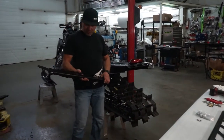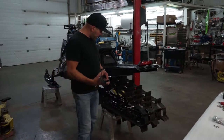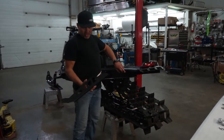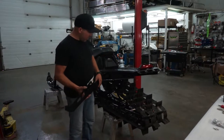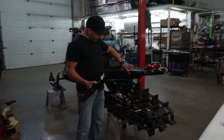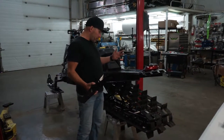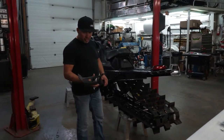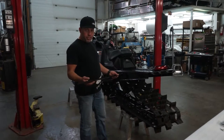So with these bumper kits, we've made these little provisions on the inside here to clear all the factory rivets that are on here. These self-piercing rivets sometimes aren't in the same spots from machine to machine, so that's why we oblong these a little bit. So what we might have to do if this bracket does not sit flat against the tunnel is just grind the head of one or two of these rivets — possibly, sometimes not. It's not a big deal because we're adding way more rivets in afterwards that are going to help strengthen it up as well.